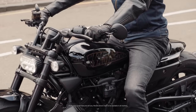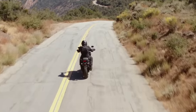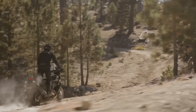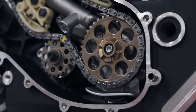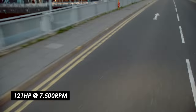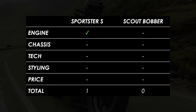Harley might have outdone them with the new Sportster S. It takes the same 1252cc liquid-cooled 60-degree V-twin first used in the Pan America adventure bike and tunes it down for more midrange and low-down torque. It retains tech like variable valve timing and lightweight engine covers, but tweaks to the valves, ports and cams increase flow velocity through the combustion chamber. The result is a 10% increase in torque between 3000 and 6000 RPM, with 121 horsepower at 7500 RPM — down from the Pan America's 150 but still impressive. That's 20 more horsepower and 30 more newton metres than the Scout, so this round clearly goes to the Harley.